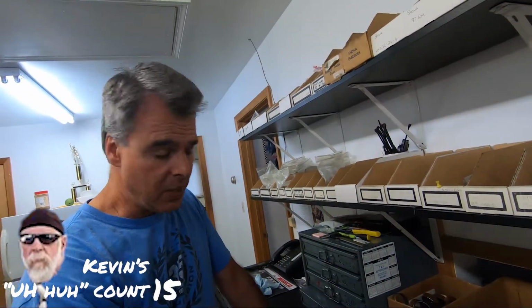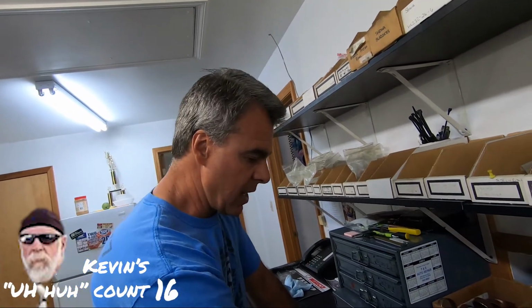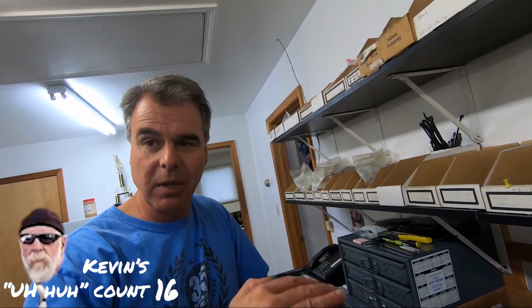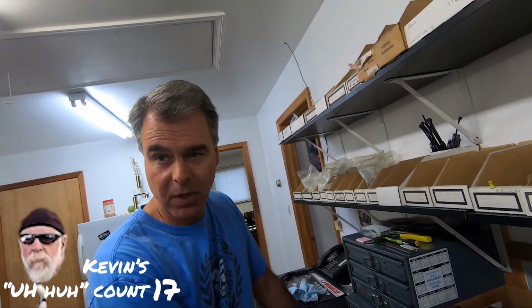In a Harley situation, this stage picks up vibration, road noise, aggregate, that kind of thing. Second stage, you step up on the bridge, you drop off the other side, pressure's increased, this picks it up. 3rd stage, you're coming down a hill, hit a big G-out at the bottom of the hill where it normally bottoms on you. This prevents you from bottoming. That's the stiffest part of your stack.